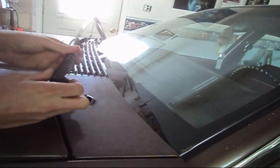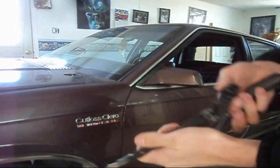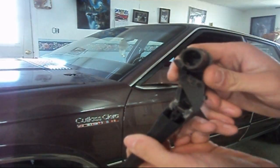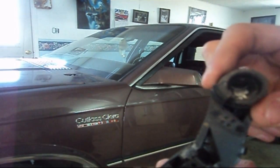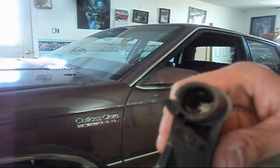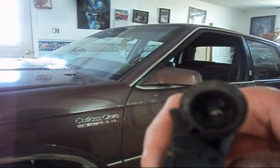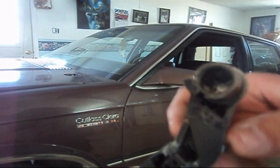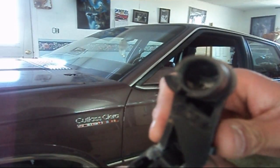On the passenger side, it does not have this notch. Looking at the wiper arm on the passenger side of our vehicle, you can see inside there are little grooves — this is what is supposed to be inside there. After time, they do wear out. And if you have a tendency of letting your windshield freeze up and use the wipers at the same time, you're going to have a problem. The wiper transmission is going to take a beating too if you keep running it with this wiper arm stripped.